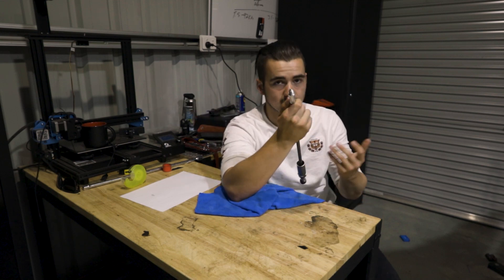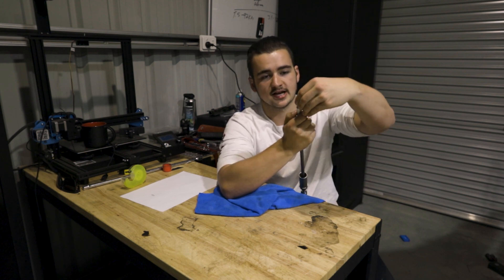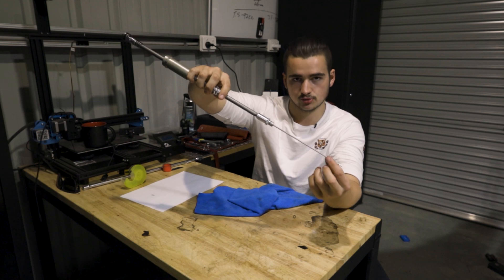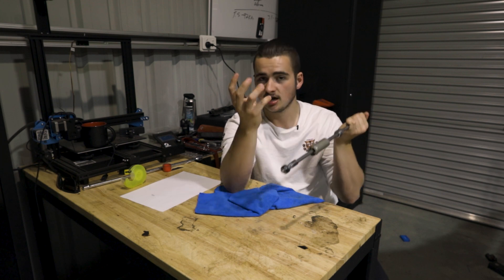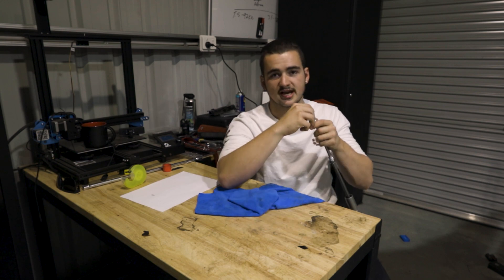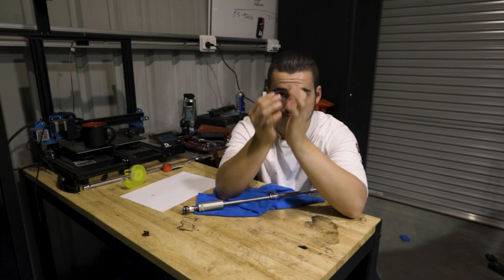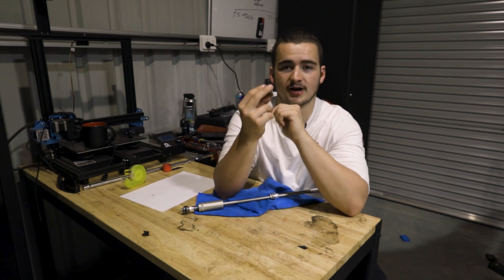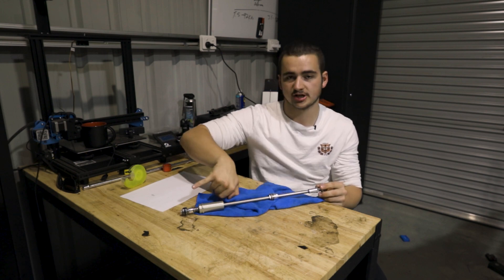With your rebound — your rebound is pretty cool. This is basically a full hollow tube. If we take off this fancy little gold nut here — don't lose it — here is the push rod. This rod actually pushes down on the stack that's in here, tightening the stack and making the rebound slower. Loosening the stack is going to make the rebound faster. So if we've got the top cap here, just to make it all go full circle — looking at the top of our forks, this is obviously turning this little bad boy here, which is putting pressure down on the stack.